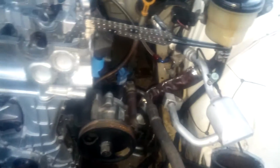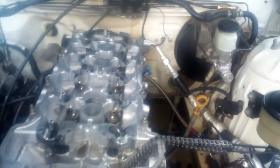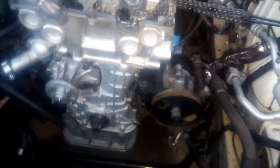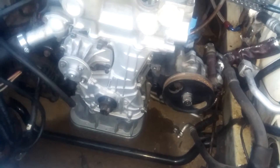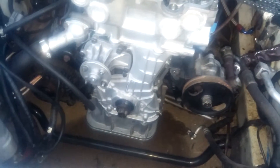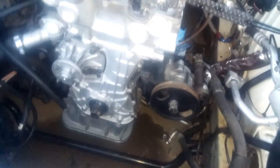After I got the head on, I zip-tied it to the power steering pump to keep tension on the chain so it wouldn't slip off and I wouldn't have to worry about whether the timing was correct or if it fell off the sprocket — which is why I tore this down to begin with. I couldn't get it to start, so I decided to start all over. I pulled the front cover off to set the timing. Now I know the timing chain is where it needs to be — the colored link on the chain is lined up with the dot on the crank sprocket.